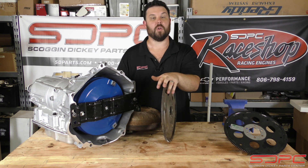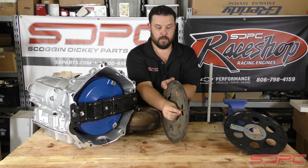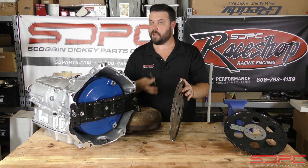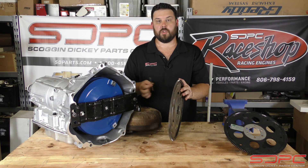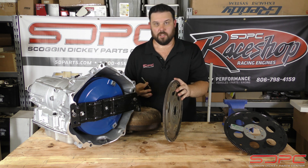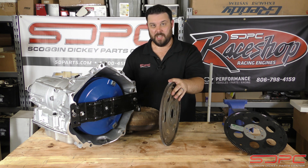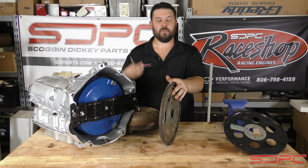If you're wondering how to measure that gap, here's an old school trick — a drill bit. You can take an eighth-inch drill bit and actually put it in between that surface and the surface here on the torque converter and see if it needs to be adjusted. Sometimes when mismatching aftermarket parts it can be a little bit difficult and you have to shim something or shim in the other direction to get it right. Please make sure to do this properly and measure it properly so you don't run into all these transmission troubles I taught you about. Learn from some of our customers and us who have seen this stuff happen and spent thousands of dollars. This is a very expensive transmission that's well worth purchasing, but could you imagine having to buy it twice just because you hated crawling underneath the car a second time? So we want to keep you from making those same mistakes.